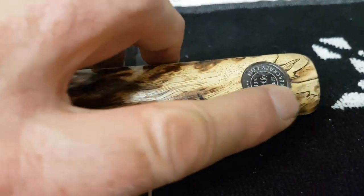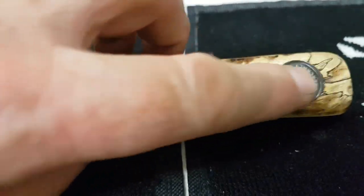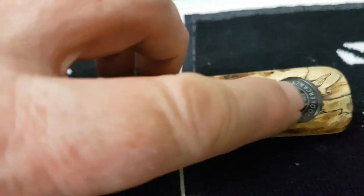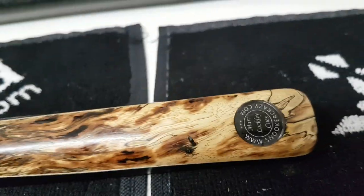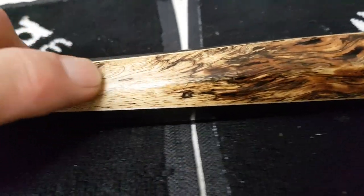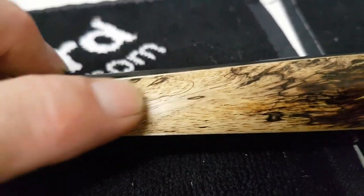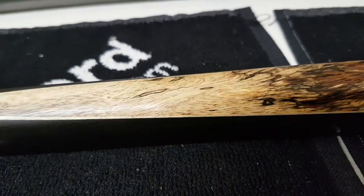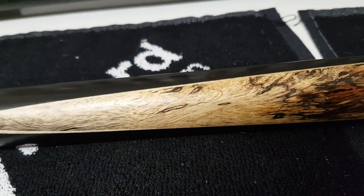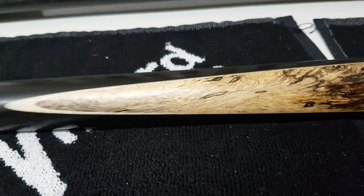Whether the badge bothered him before is difficult to say, but it feels pretty good now. We get up to something like a 3000 grit — I'll always start with a file, a second-cut file as they call it, and then go through the grades. Sometimes a 400, but generally if it's an older badge that just wants a bit of finishing, I'll just lightly do a 600 and work up to a 1200 and then 3000 for acrylic ones. The dent itself was a bit of a pain. In the end it wouldn't come out with just dampening it down, so I steamed that. If you're going to do steaming, you really want to be more experienced at it, because the first thing you do when you start putting steam around splices and laminates is they want to come out and you've got another thing to repair. But if you're careful and you've done a few, you know how far to push it — and you can't even feel that now, it's completely gone.